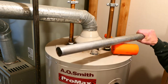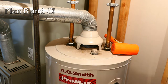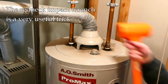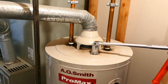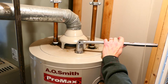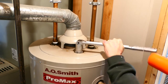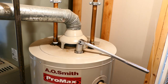So two tricks we can try: one is just a pipe I can slide over the handle and give myself more leverage. Before I even do that, let me try this — kind of a redneck version of an impact wrench. You can take a dead blow hammer and hit the end of the handle, and that'll apply a whole bunch of force. We'll give that a shot. Not too much luck there, so let me try the pipe next.